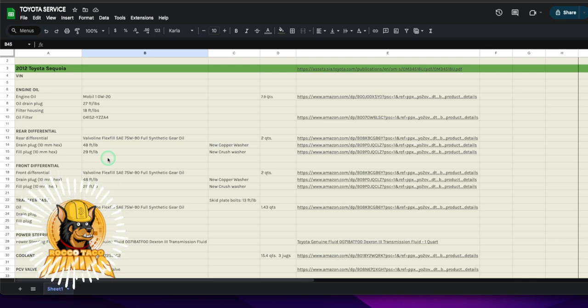I have lube for protecting the underside — PB Blaster surface shield, rust-busting stuff to get bolts off. That stuff works. I soak stubborn bolts a week ahead of time. On the differential, there was some rust — it's a 10mm Allen, I thought it was going to strip — but after soaking, wire-brushing, and five taps with a hammer, the thing came off so easily. Same on the transfer case and front diff.